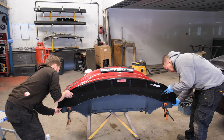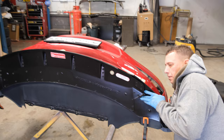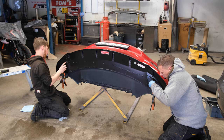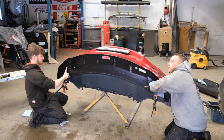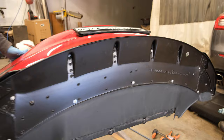Now getting it onto the bumper. By doing it this way, we can make sure everything fits correctly. Ad has his first bolt holes drilled and the bonding agent on. He also put a primer coat on as well, just to make sure it bonds fully to the bumper. Got the first two bolts on and done up, and then any other holes along that front section will be drilled as well. We're now going to get the bumper back onto the Tesla — all bolted on now with a lovely load of bolts and screws through the bottom, plus our bonder to hold it all on.